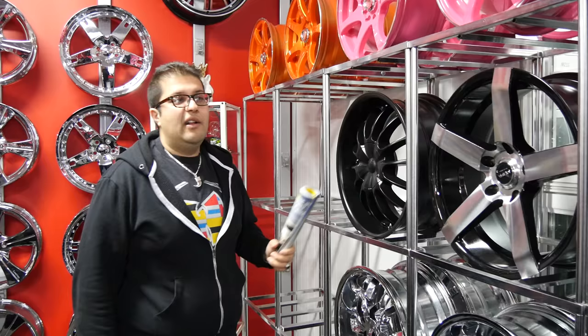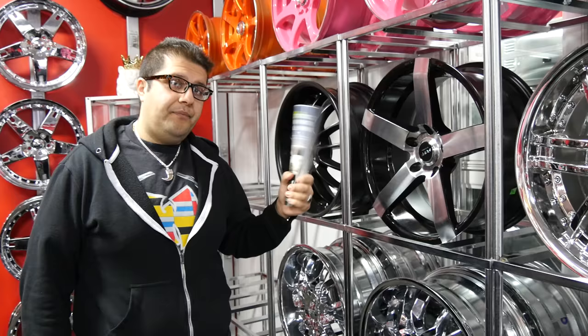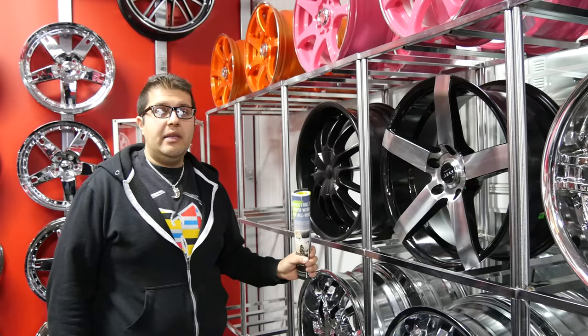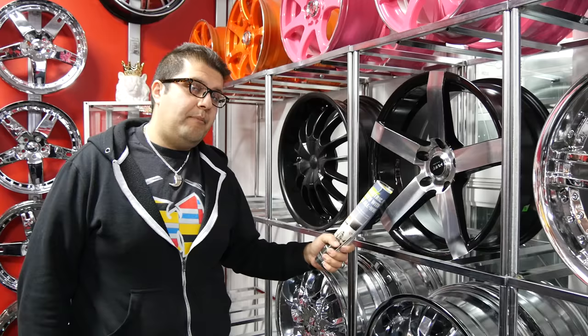So let's say you have a vehicle — let's say you're driving a Honda Civic and the vehicle is all black with black tinted windows. The number one option, in my opinion, would be to go with the matte black wheel because black on black is a great combination. But black and machined will also work. Matte black is totally no maintenance — there's no clear coat so it won't peel, it's totally powder coated. For black and machined, it's shinier but does have a clear coat finish, which means if you don't maintain these wheels and get the brake dust off, they will eventually peel or the clear coat will start peeling. So that's something you've got to keep in mind.